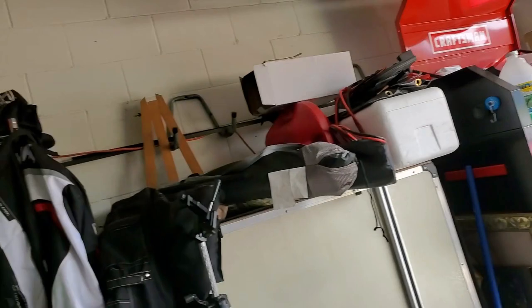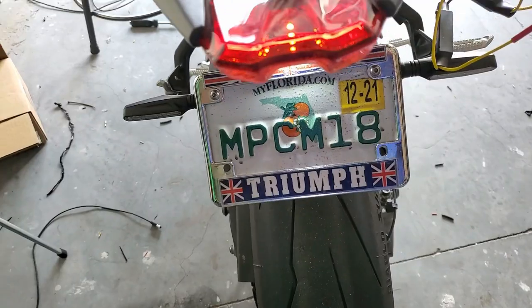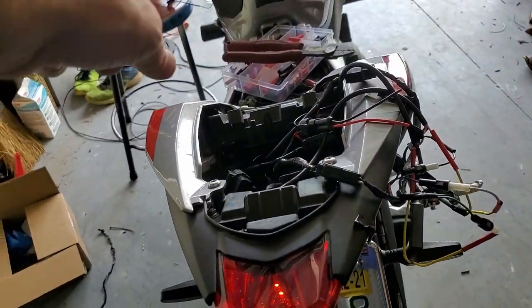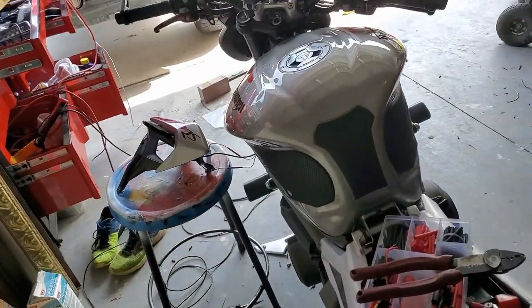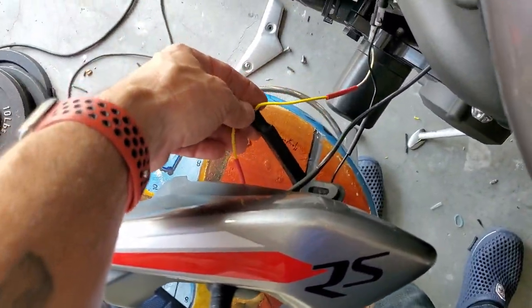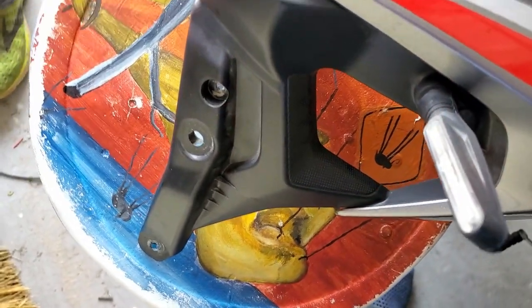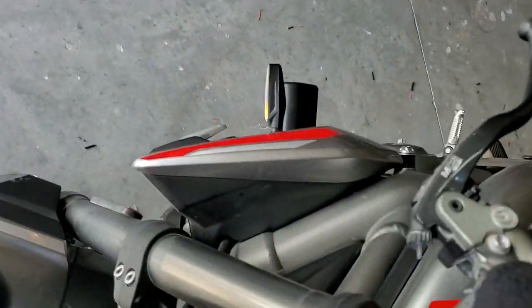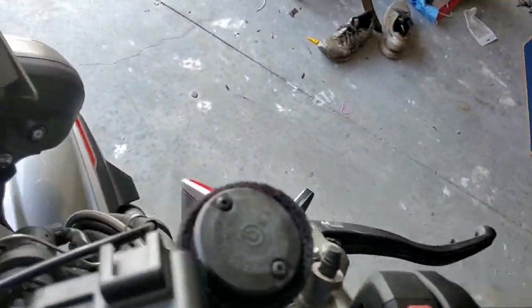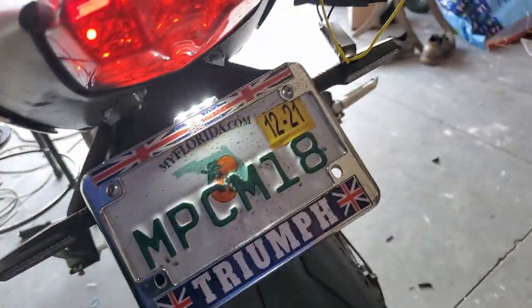What I had to do is get some resistors and put them on. I couldn't get every one to work — when I put the resistor on the back one, it started working, but then the front left one wouldn't work. So I went ahead and put resistors on both and put the resistor on the front. You can see it's a giant mess. I put the resistor on the front, now this one starts working — back one works. But now the front... if I hit the hazards, everything works except the front right.